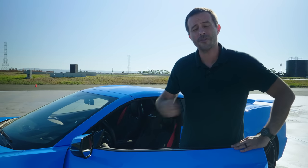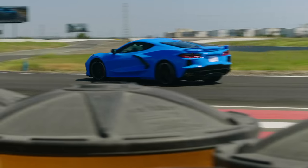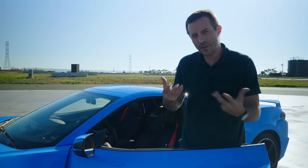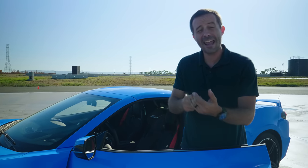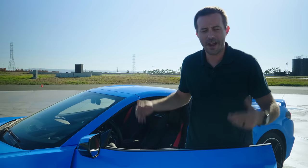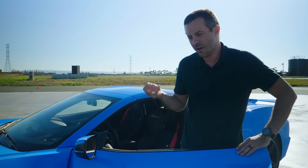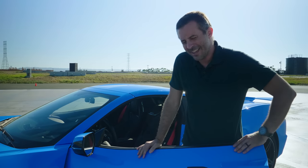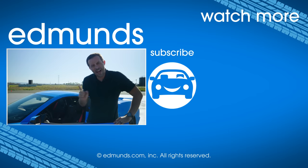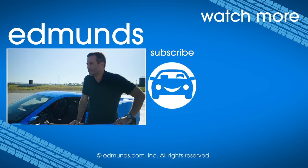A skid pad test shows you one specific attribute of overall vehicle grip, but it's not a racetrack — it doesn't have the variety and complexity of corners you might experience there. As part of our testing protocol, we also drive all vehicles around a handling track. When we did that with this car in both alignment settings, our team reported that the street alignment setting had more perceivable understeer than the track alignment setting. That understeer would slow you down on track and reduces confidence in the car. That's why you do the track alignment setting — which, come to think of it, is exactly what the owner's manual says. So we haven't really proved anything, but we validated it, and validating is a very important part of testing.